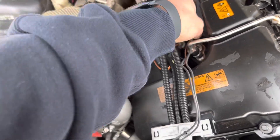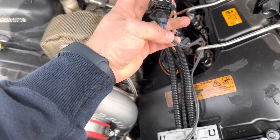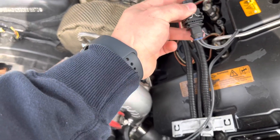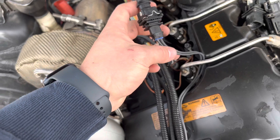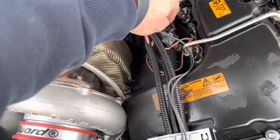You can get one on Amazon, but you would have to cut the connector. Your generic one is just going to come with two leads and you wire one of these wires to each of the factory ones. These have no polarity, so it doesn't matter which one goes to which — you can't really mess that up.